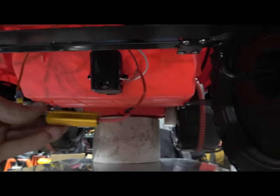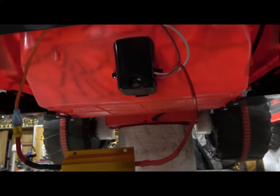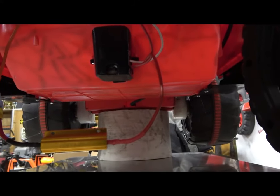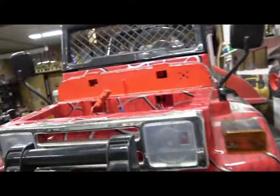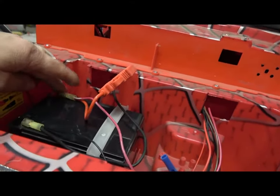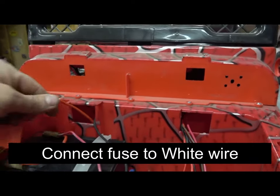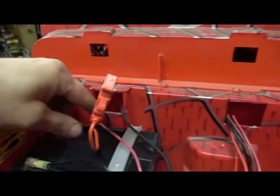You're going to cut that orange wire and wire in one of these resistors. I'll put the Amazon link in the description — the value is a 100 watt, half ohm resistor. For the battery side, you've got power coming from your battery into a 30 amp fuse, going down into the stock Power Wheels harness, and same with your ground.